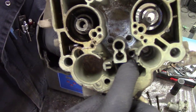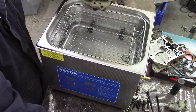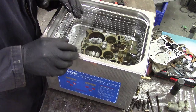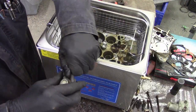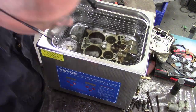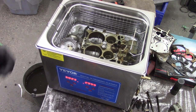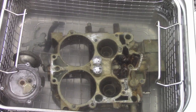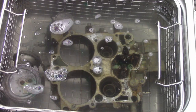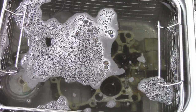Down in the bottom of this hole is the little ball that keeps fuel in for the accelerator pump circuit. You get a new one in your kit, but it took a bit of playing to get that guy out — it was definitely stuck in there. This is an ultrasonic cleaner I just got as an experiment to see how well it does on carburetors. This footage is horrifically sped up — you can see the clock clicking by. This thing heats up; I got it to about 80 degrees Celsius.